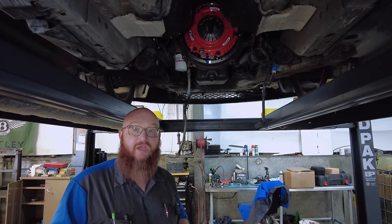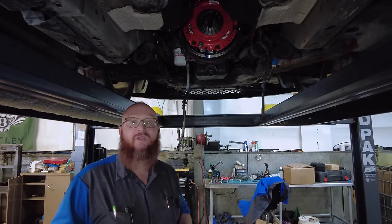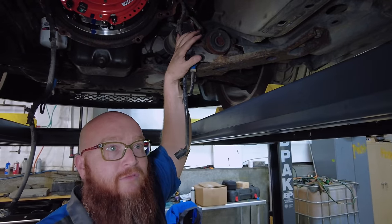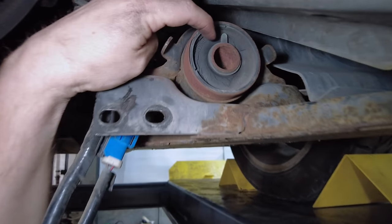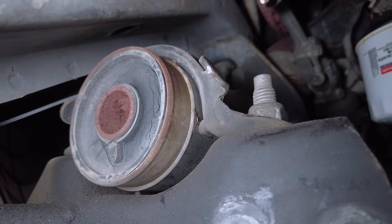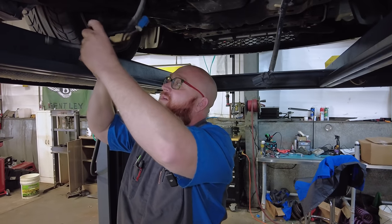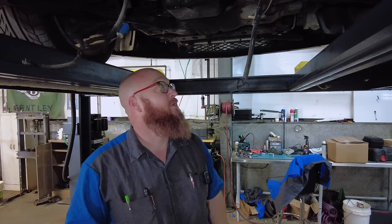There were still more issues to take care of with this vehicle. Hoovy mentioned a little bit of tramline — if you go over certain road surfaces, it pulls this way or that. I know what it is: it's these control arm bushings. You can literally see the cracks running through them. With 210,000 miles, it's not surprising. The driver's side has just as much if not worse cracks — the rubber is separating from the housing. That explains the weird steering feeling. I actually have whole new lower control arms — just put all new ones on it, and that'll take care of that.